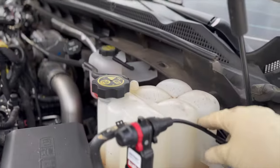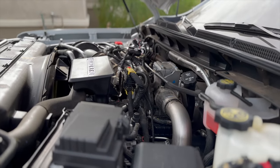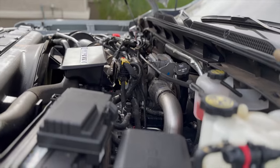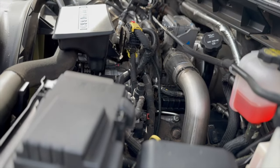Now that I've got all the exterior under-hood harnesses installed, I'm going to start zip tying them. It's kind of tedious and it's your preference of how you want to zip tie it. I like to keep it along the factory harness because it keeps you out of the way of anything chafing. I routed it close to the fuse block — there's a little tray down here. Try to keep it away from the battery in case your battery leaks battery acid onto the Derringer harness. I'm just going to do a little time-lapse of the zip tying.